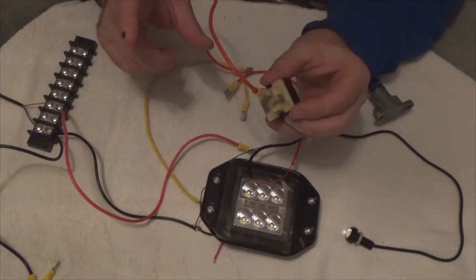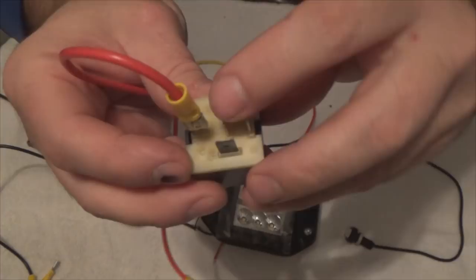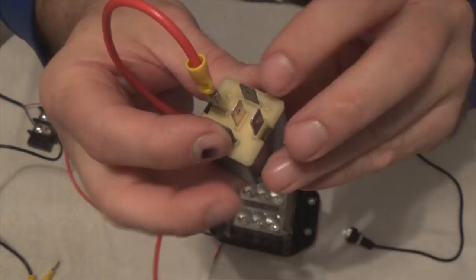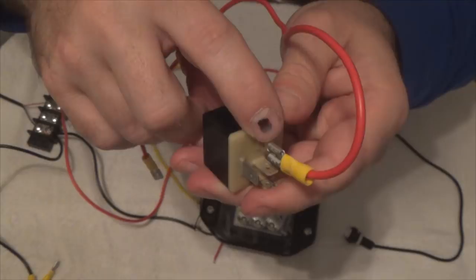Now let's wire up a relay. I'll show you guys how to wire the relay up, and if you want more relay videos, I'll put a link in the description to my series on how relays work and how to wire them up in different configurations. On a relay, these two posts are always your accessory posts — your trigger posts, meaning they turn it on and off. One side goes to ground, the other will go to your switch. This will always go to your power source, your battery or whatever it may be.